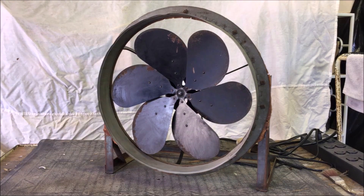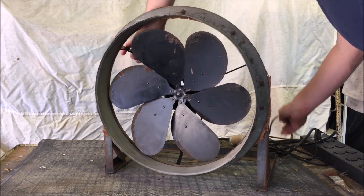Now, as to that startup issue — it seems like there is a spot in this motor where the magnetic field doesn't rotate. When the rotor is in the right spot, it will attract to this place like a compass needle pointing north. When power is applied, once the fan gets going, momentum carries it past this spot every revolution, and this causes the motor to run roughly, like a misfiring car engine.